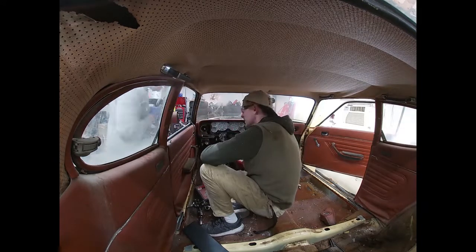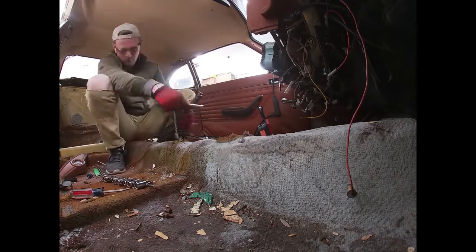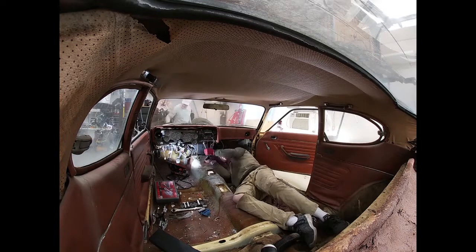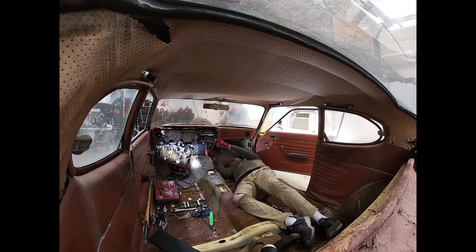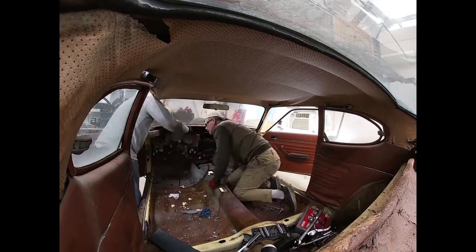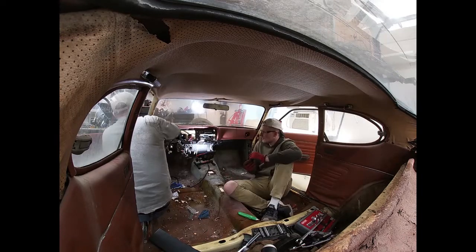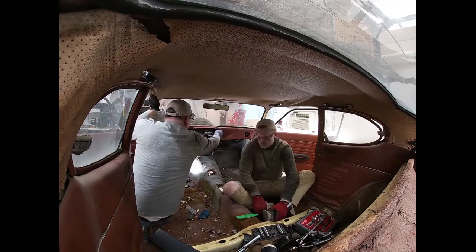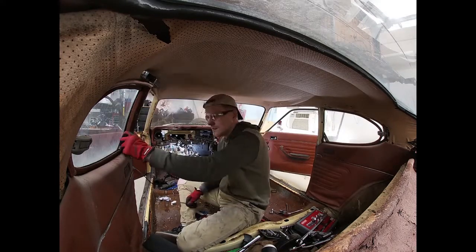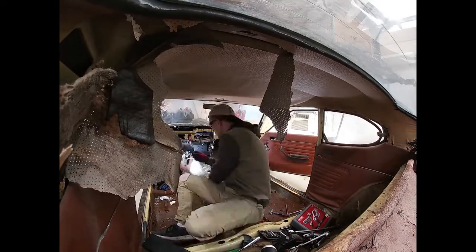Or it turns out the Ford Ranger used that same 7.5-inch Ford axle, and the early Ranger anyway is close to the same width as the Capri axle. So if we can find an early Ranger axle, and if the disc brake components will bolt to it, those are big F's. Anyway, I've got to do some research there, because I'd rather not cut the Mercury, although those wheel wells are completely rusted out anyway, and it wouldn't really matter. It's just kind of the principle of the thing, why would you do that to a classic, right?